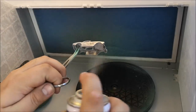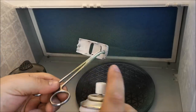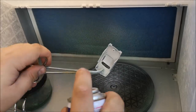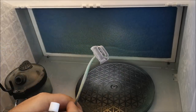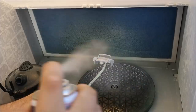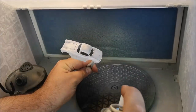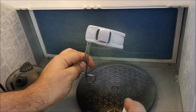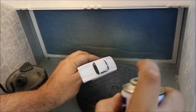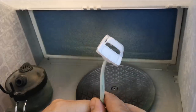Make sure that you fully shake it up and try to warm it up if possible. I just rub it in my hands to take a little bit of the cold temperature out of it and chuck it on the car. I haven't yet managed to overdo this paint or put any runs into it — it seems really easy to use and almost foolproof. I always go with just a single relatively heavy coat straight from the off and it takes a couple of minutes to dry off ready for top coat. That's literally it, nice and easy.